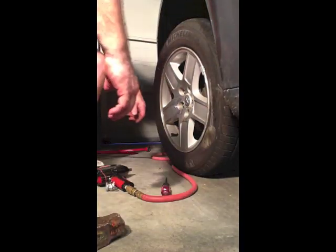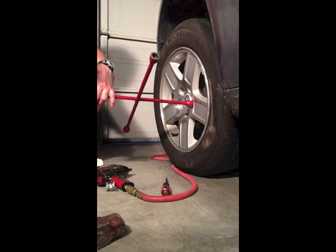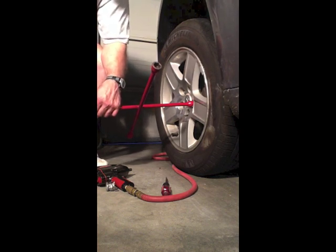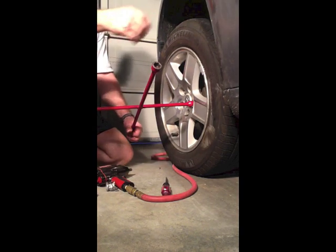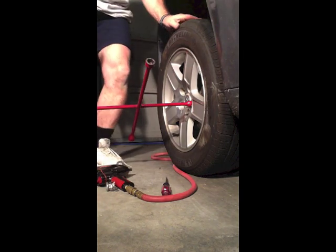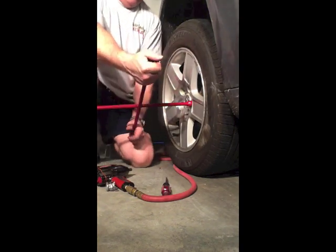We're going to have to get our four-way. Since we've taken the outer skin off, it's going to be a little bit smaller than the bolt that it was. Now notice the four-way doesn't go all the way on — that's because the bolt is rounded on the inside where the aluminum shell rounded it off. So tap on this straight in with the four-way to get it really good, because this is your last chance. You mess this one up, you're in deep trouble. I bench press about 300 pounds and I don't even know how tight that bolt is — it's way above specification. I don't trust this, so I'm going to tap it on a little bit more, because the last thing I want to do is round this bolt off. I am out of options.